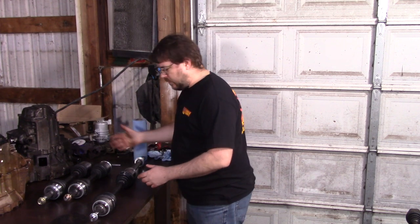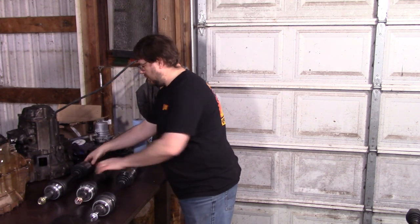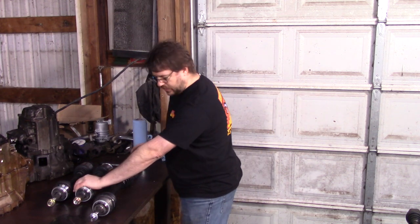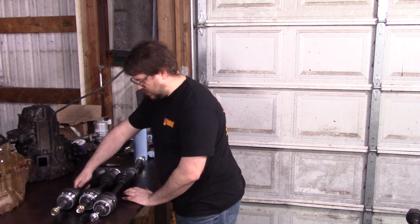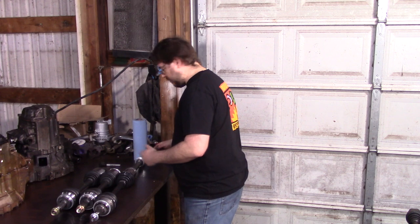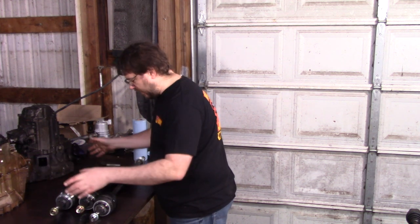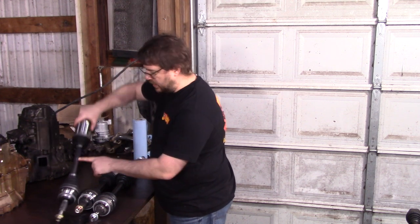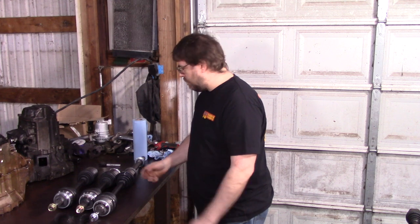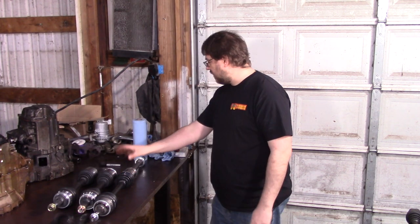All right, we got these out. First thing that's obvious is this one here has a small spline, so we're obviously not using this. We've got the large inner spline on this one, and obviously the long axle shaft, so we're definitely using this one. And given that we're making small axle shafts, I'm going to guess that this one gets thrown out. Now I did write the part numbers on here so I don't forget — but they've also labeled them from the factory. The 8154 is the big spline, 8156 is the small spline, and 8246 is the long one.